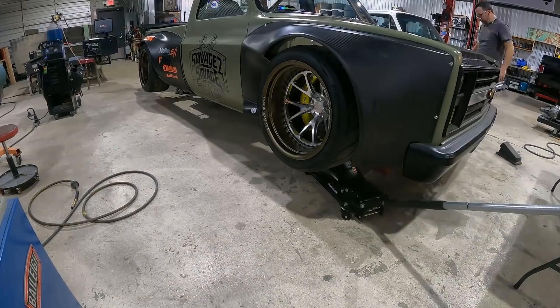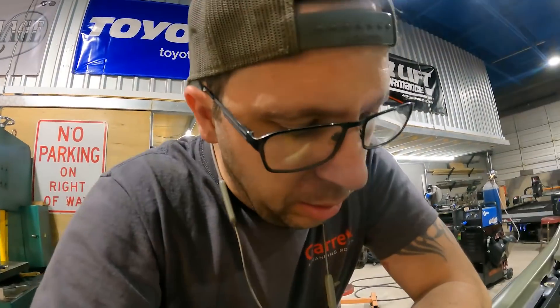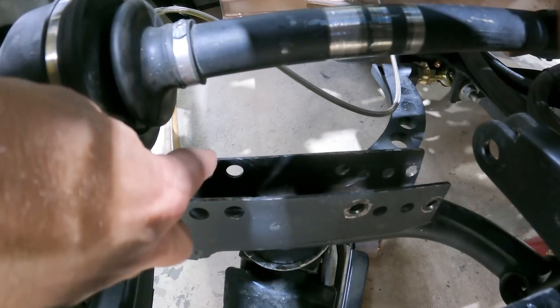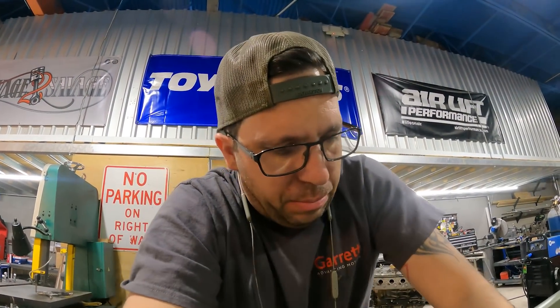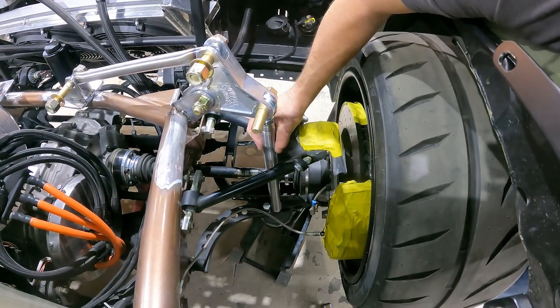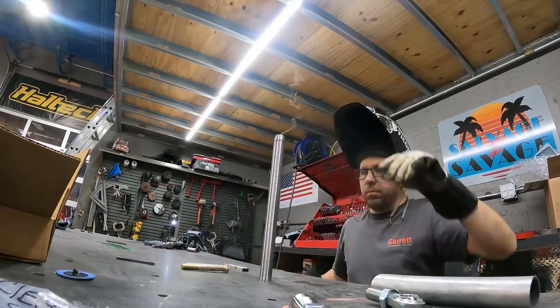The wheel is positioned exactly where we want it — I'm about a quarter inch off from the rear, which isn't a huge deal since we can raise the rear once it's on the ground. The front end is pretty much situated. The only question now is where we're actually going to mount our lower heim to our lower control arm. I want to go to the outside of the front of the control arm with a through bolt through the entire lower control arm. I'm going to measure the chromoly tube long so we can cut it, stick it in there on either end of the half shaft, and see if it clears. Up behind the half shaft looks like it's going to work — there's good room back there, just need to clearance that web a little bit.